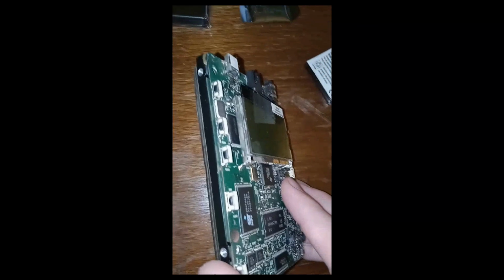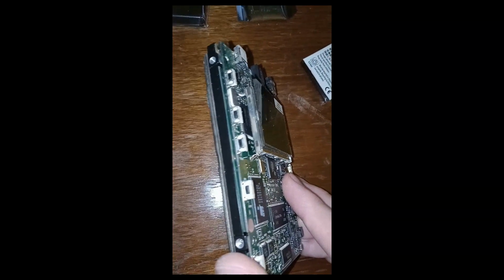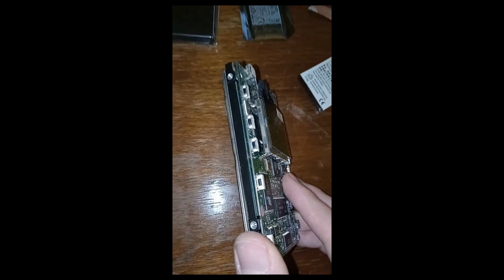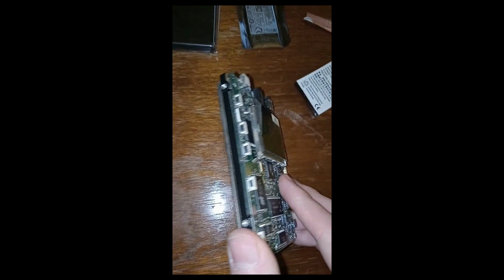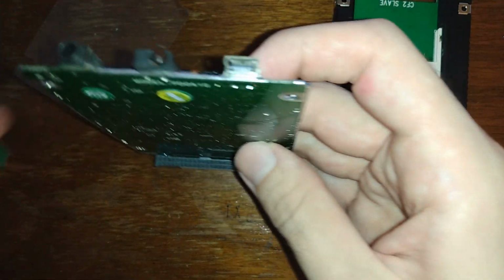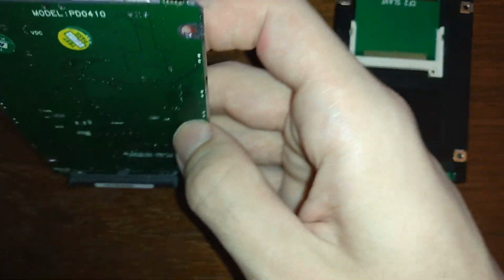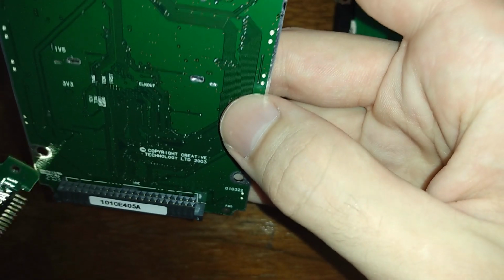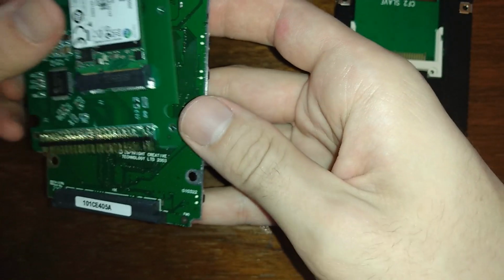In a perfect world, this would be a plug-and-play fix, but the design of the Zen NX presents one major problem. Given how bulky its housing is, the 44-pin socket on its PCB was designed to be as compact and low-profile as possible, and its pins and traces are quite fragile. The screws that secure the hard drive to the housing run through the PCB, effectively compressing the three components together.